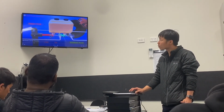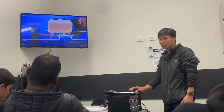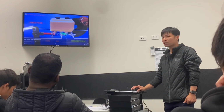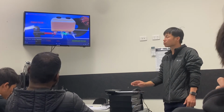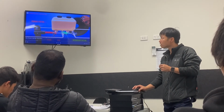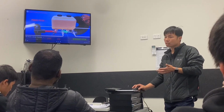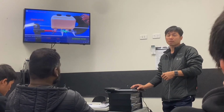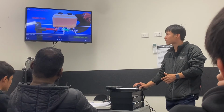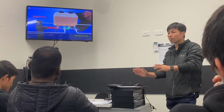So normally when you apply the push rod here, the brake is pushed here, being driven by the fluid. So fluid is pushing the secondary piston as well, not by the mechanical push rod. But why it's still designed here is because, as I told you, if the leaking is from the primary system here, say this pipe is leaking, no brake. All the brake fluid when you apply here will go to here, so it will not push the secondary piston. In that case, you will lose your secondary pressure too. That is why you design another push rod, in case this one fails, you can still use this one. That is why you have an inlay here to keep it all separate.